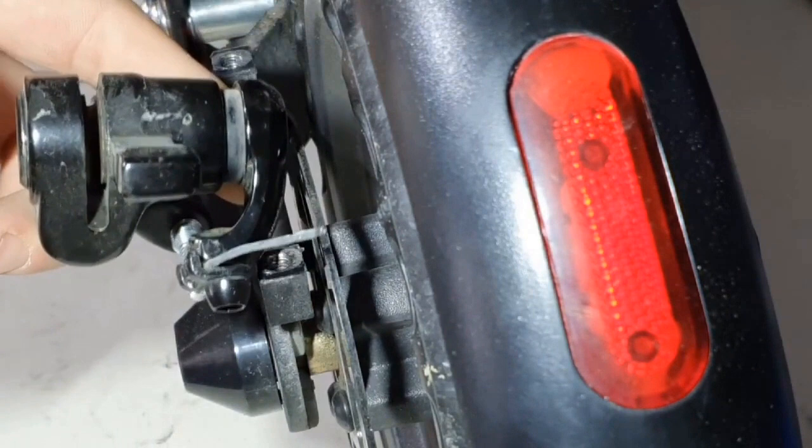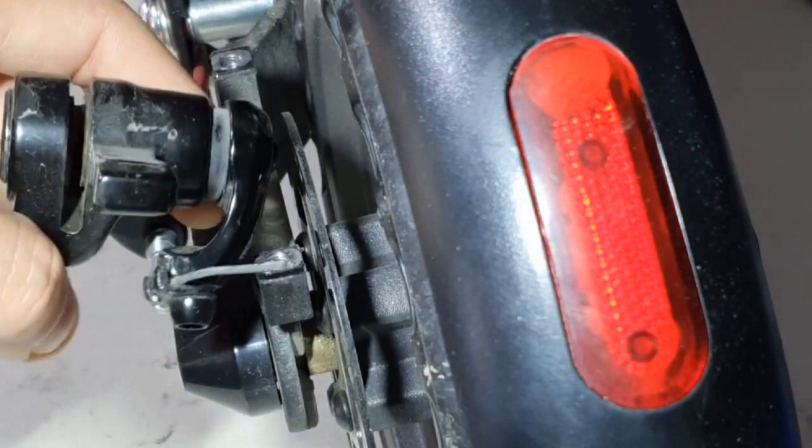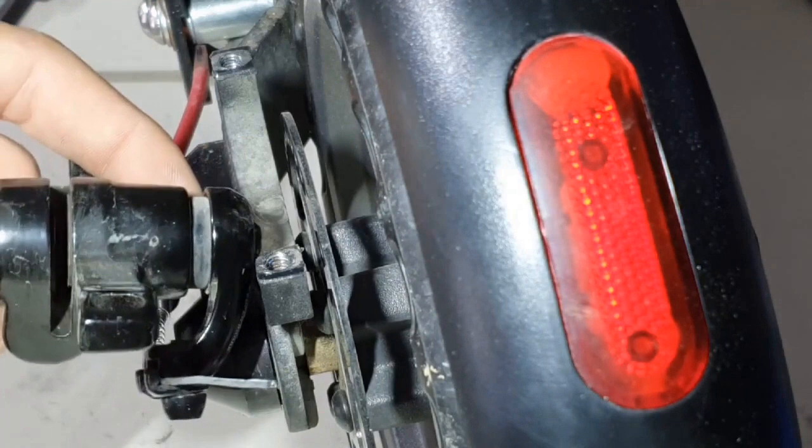If you have a squeaking noise in the brake, you can check it again quickly. Pull off the brake pads and sand them with sandpaper, or clean the disc with brake cleaner. Then the squeaking should also be addressed. We'll do it promptly, then remount the caliper and demonstrate the setting.